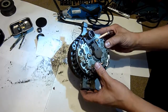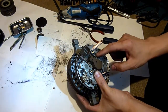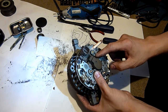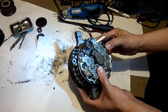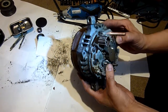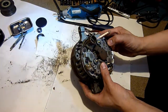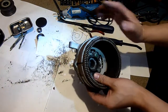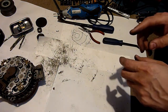So the logic is, if I want to change the brush, those two screws there are not really wanting to budge. You have to really find the right screwdriver or drill the thing out. Looks like one of them drill the thing out kind of jobs. So it's quite irritating if I had to change the brush. Luckily I don't need to. I'm just going to leave that as it is. So the logic is, leave it, press the bearing out, the front bearing,